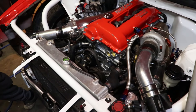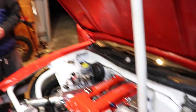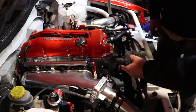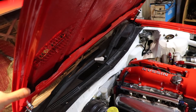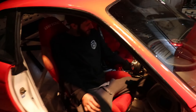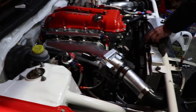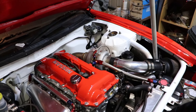It was cold. She's a bit rough when she's cold. First ever start - it's rough. I'm stoked! It works! I'm surprised. She's got some dirty fuel probably - might need to clean that filter. Got some bubbles in the cooling system there.